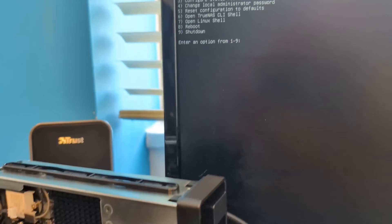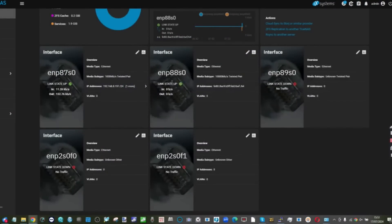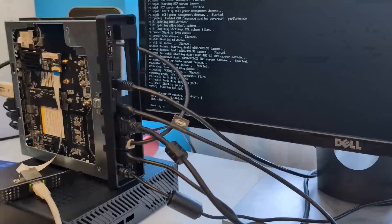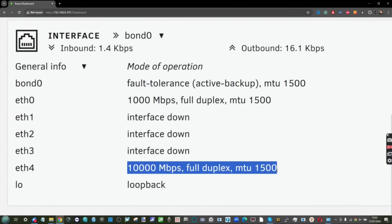Now that's all the bad news. The good news is Unraid and TrueNAS worked like a charm — specifically TrueNAS Scale and Unraid 7.1 beta. Those two were the only platforms that were not only able to see this device but could actually interface with the system, and both were giving me 10,000 megabits per second — full 10 gig. Unsurprisingly, turnkey NAS solutions failed due to the lack of drivers in their pre-built operating systems, and there's no guarantee that even soft-patching drivers would work on a turnkey NAS.